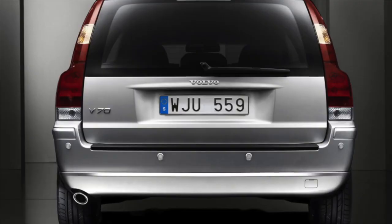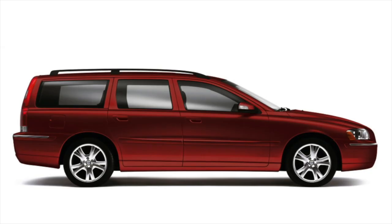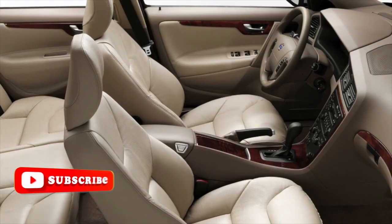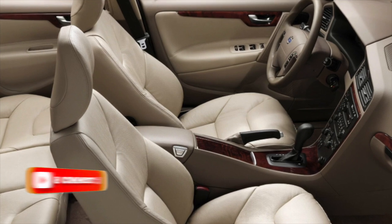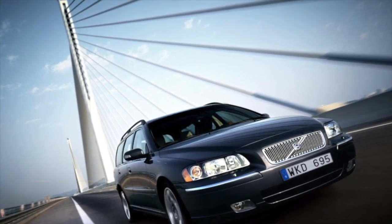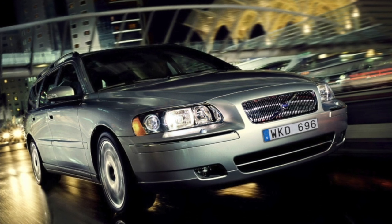The CV joint can still be purchased new, since transmission elements from the S60 are suitable. Manual gearboxes M56, M58, and M66 were developed for the 850, then used on the S70 and the next S60. The average service life before a rebuild with replacement of the bearing set is 250–300 thousand kilometers. Differential bearings are especially affected, and for active drivers, synchronizers are also worn out. Collapsing rings of compound synchronizers can now be found only on a miraculously preserved gearbox with runs under 50 thousand.